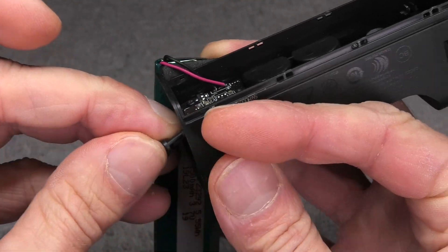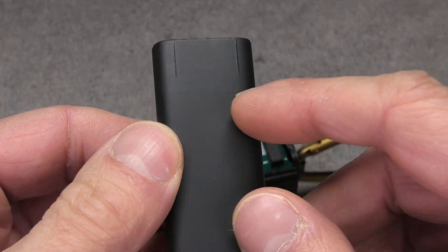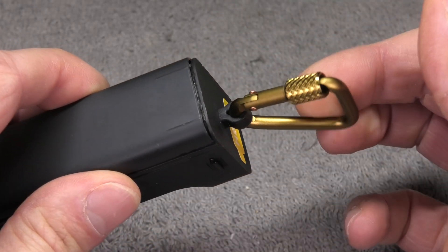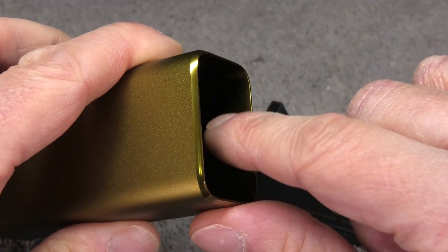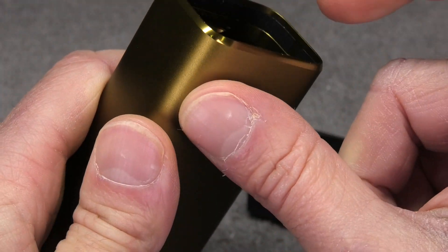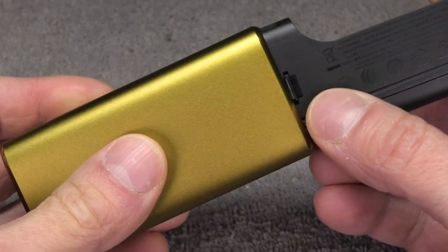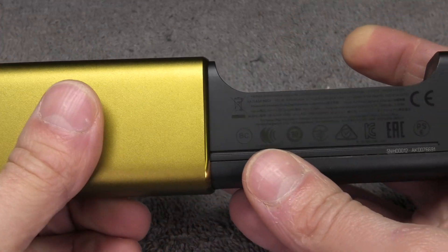We add the dust cover back by poking it through, then put the battery back in place. When adding the back cover, look for the two little lines - those are supposed to face towards the carabiner, so make sure you orient it correctly. Then press the cover on and it should click into place. For the metal case, one side has a little rubber lip inside - start by pushing the inside of the charging case in carabiner-first, push the two plastic pins in on the side, and then slide the two pieces together.